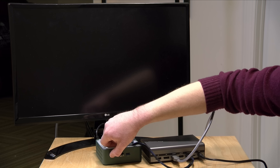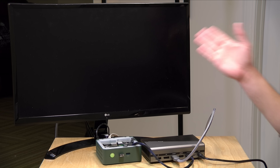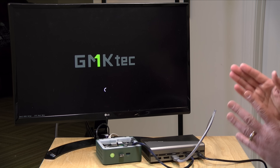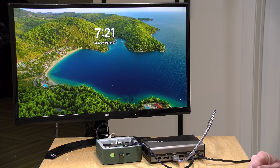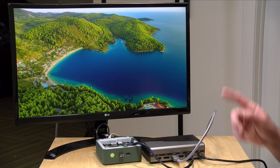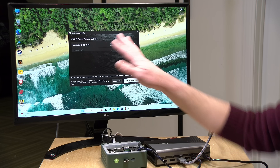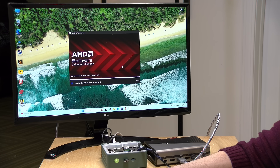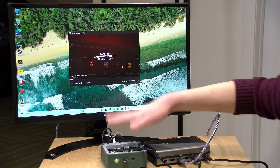I want to note that I'm running the HDMI cable out of the eGPU and not from the HDMI output on the mini PC, because for the best performance you always want your video coming out of your GPU. When I hit the power button — there it is — the GPU powers up the display as it boots, so far so good. The GPU is connected directly to the system bus. We're booting right up to Windows, and this GPU is now considered part of the system bus — that is how Oculink works.